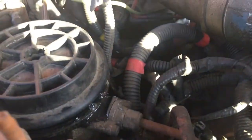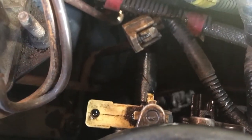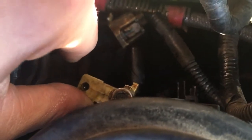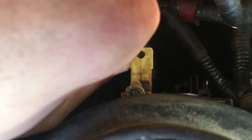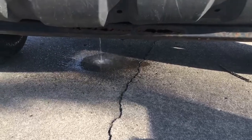I forgot a step — you need to drain this before you start taking this apart. On the back here there's a yellow knob. You're gonna reach down here and turn it 90 degrees clockwise like this, and you'll have a little bit of diesel come out of there.